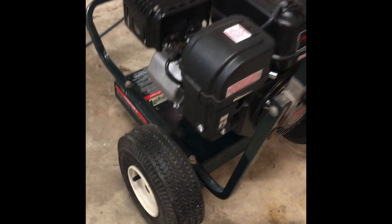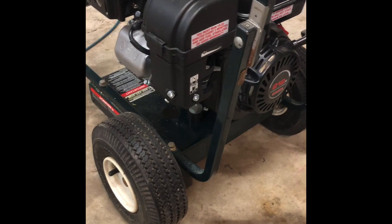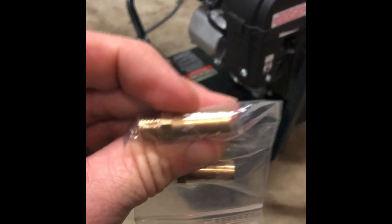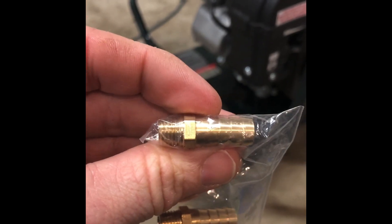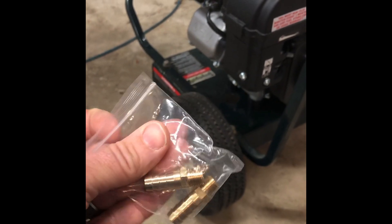So I tried to come up with an idea to do a kidney loop — a bypass oil filter. I bought a couple of things to piece that together. The first was a set of barbed fittings with an M10 by 1.25 thread. I picked these up off Amazon for just a couple of bucks — two barbed fittings.